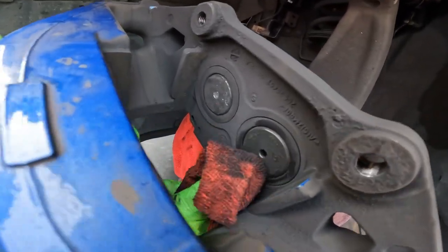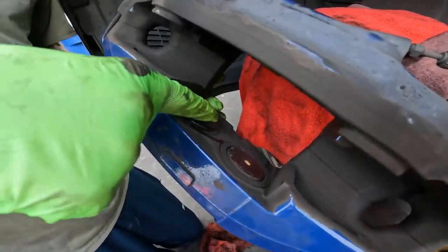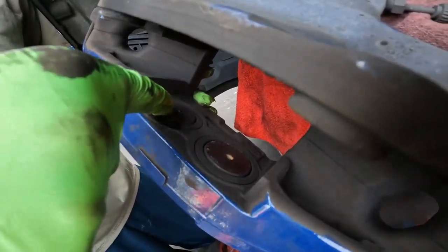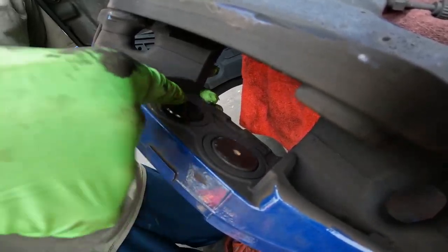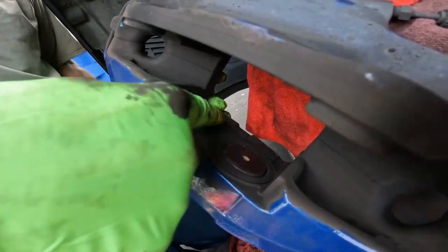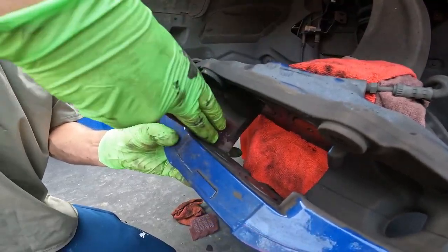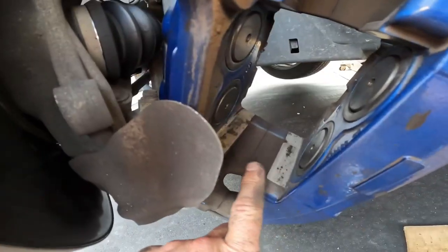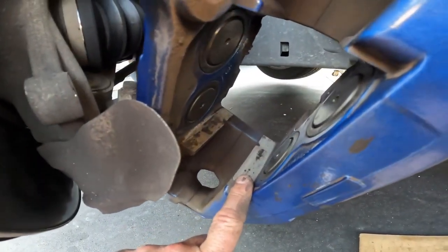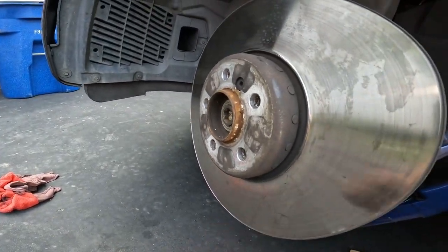and remove the adhesive. Tiny piece of Scotch-Brite also works good. Spray with a little bit of the cleaner and go ahead and gently rub to remove the adhesive. You want this nice and clean and dry, because we have to stick the new pads onto this brake caliper. Scotch-Brite on the two sides, on each side of the caliper. So all of these surfaces are nice and clean, and that was just done using some Scotch-Brite. Now it's on to removing the rotor itself.